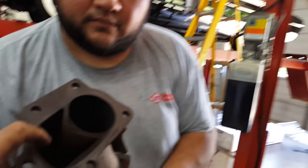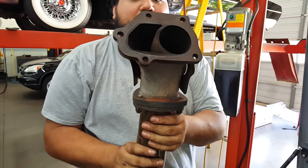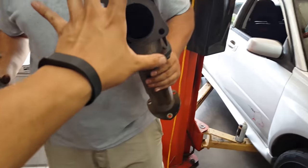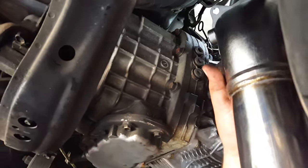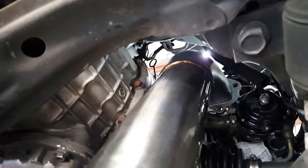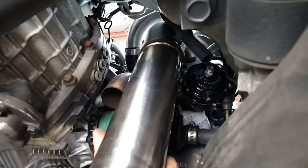Now this is what I was talking about with the divided mouth — this is the only area it has to exit since I have no internal wastegate. But this is great for internals. Look at that — this whole downpipe alone is lighter than just this single piece right here. Ridiculous. Now, since this one is a one-piece downpipe, it has to go in from the bottom instead of the top. So hopefully we can snake our way through here with the external wastegate.